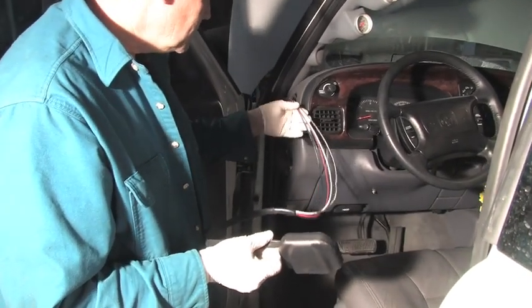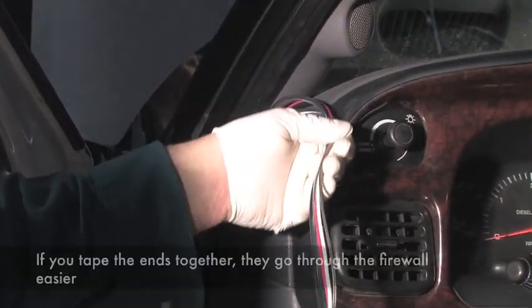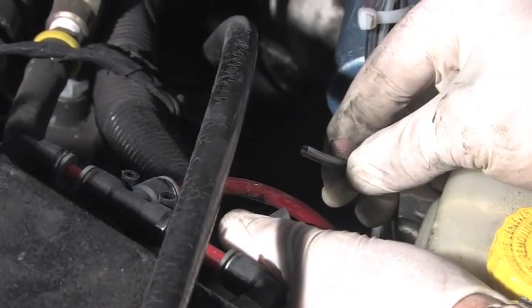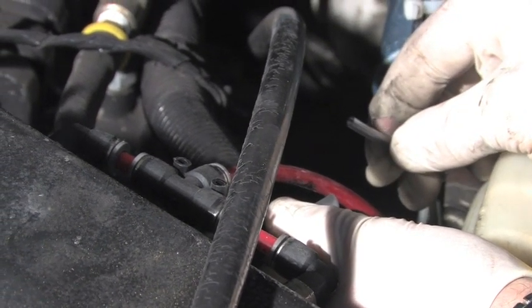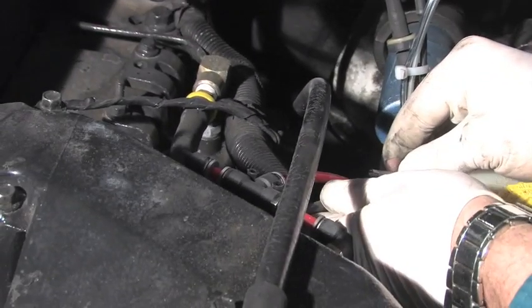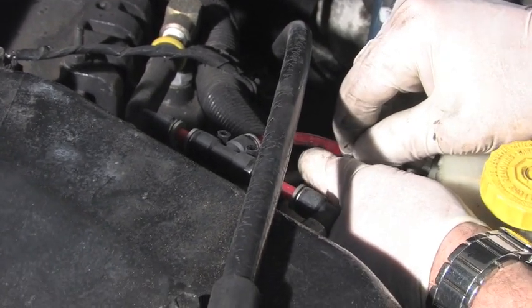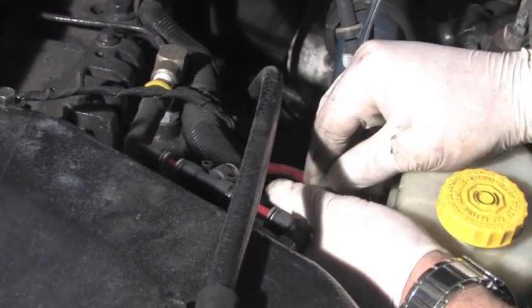We will begin by threading all of the wires and turbo boost tube through the dash and then through an access port in the firewall. With all of the cable and also turbo boost pressure line run through the dash and the firewall, we're now ready to connect to the inlet of the engine, using the black rubber hose supplied with the kit.